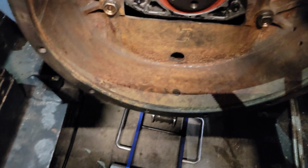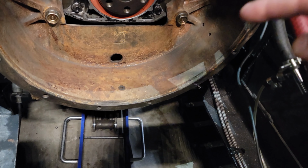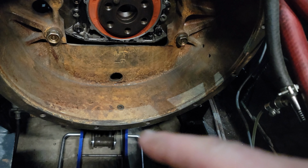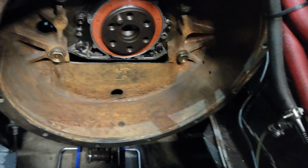So, on the Isuzu transmission, the lower part of the bell housing on the transmission is cut out. There's like a little window in it. On this, the area that I need to get to with bolts for the flex plate and the torque converter are in the bell housing area. So what I think I'm going to do is eliminate those lower two bolt holes and just make a little window right there. So cut that piece out.